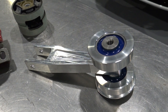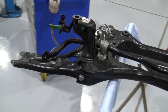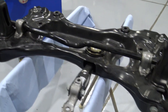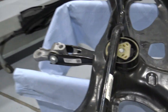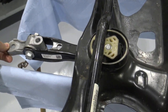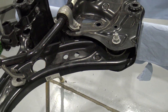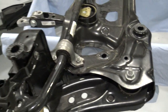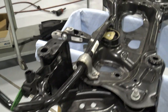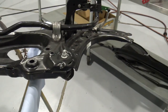I'll give you an indication of where it all goes. Here is our subframe sitting out of the car. You'll notice here is the Dogbone Mount and how it sits in — you can see how flexible it is in standard form. Here are the stock control arms sitting in place. You'll notice they are all fully rubber bushed with a lot of play in them. And here is the factory sway bar unit.